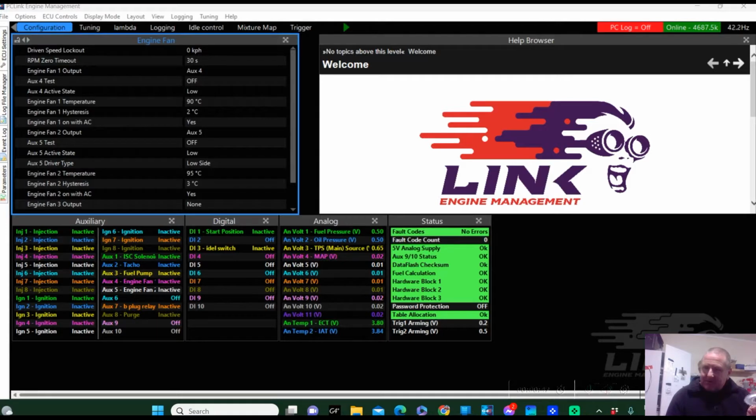Interesting situation recently, we were playing on the dyno and scoping different pictures and patterns, and we found that the 36-2 improved the cyclic idle. It was actually a randomized idle rev cut, and it was improved by the 36-2. I always had a feeling that there was a good reason I supply 36-2s when we do these UZ jobs, and that just confirmed it, because we did find slightly better resolution and it improved the way the ECU worked.